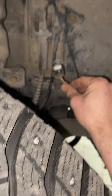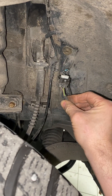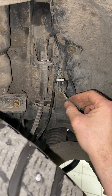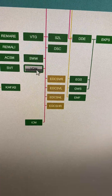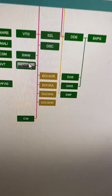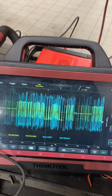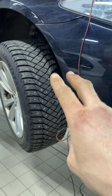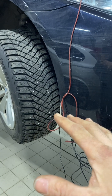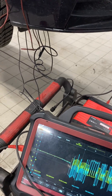I'll go through a diagram again to show you why that's important. By putting that resistor across the FlexRay we've basically closed an open circuit and we're now allowing the VDM to communicate, which it didn't do before. We've got VDM comms now — they're not connected so that's okay, but we've got VDM comms which is fantastic. Now if we pull the terminating resistor out from the front right, it's going to sever the VDM's connection to the FlexRay bus and in theory there will be no bus or a very bad signal.